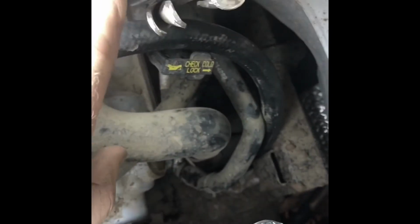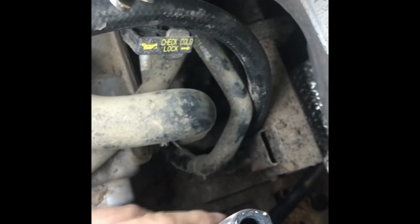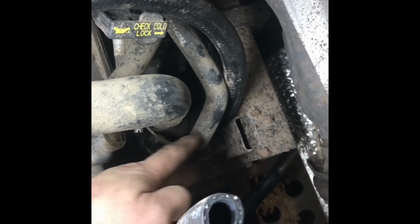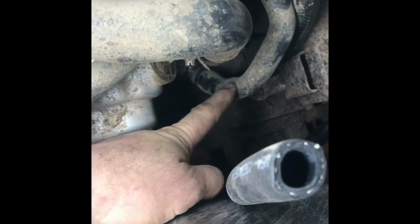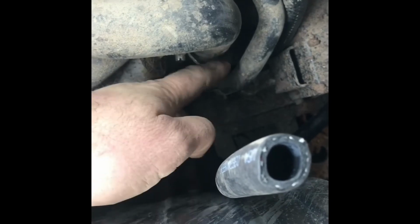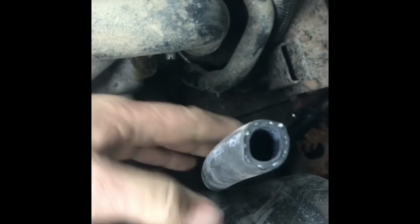As these things vibrate, sticks, mud, it's just inevitable you're going to get a hole somewhere. But you want to put some little insurances in there so it doesn't happen. Okay, we're getting closer. So I've got this hose ran on that side where I want it. I've got this hose clamped, this little bypass hose. I've got this clamp loosened and up just a little bit, and I took the pliers and broke this hose loose from the water pump just a little bit, so it'll be easier to slide off, because you want to slide this off and then put this on real quick.